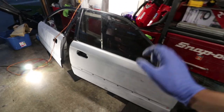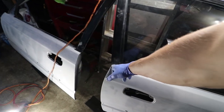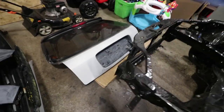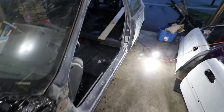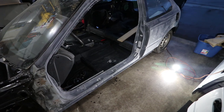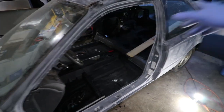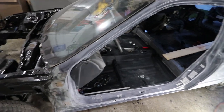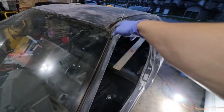The doors are there but I still need to take off the molding pieces so I can get sanding underneath and mask the doors off. On the hatch itself, I need to figure out how to get that trim piece off so I can fix up that black line left by the previous paint job. Then I'm going to give the car a thorough wipe down a couple of times until I get no dust on the cloth, and start back-taping the doors and hatch to get this thing ready for primer.